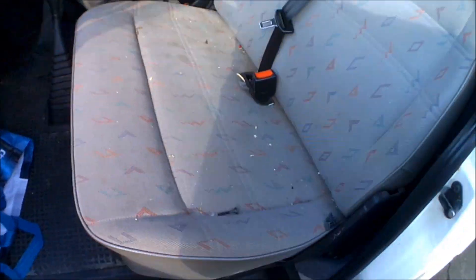Right, it's time to get the double seat out. Underneath the double seat you generally have six mushroom bolts — one in each corner and one along the middle as well. Typically on this one, five of them came out fine; one was a real pain but managed to get it out without rounding it, so now it'll just tilt forward and that's the base loose and ready for the seat to come out.